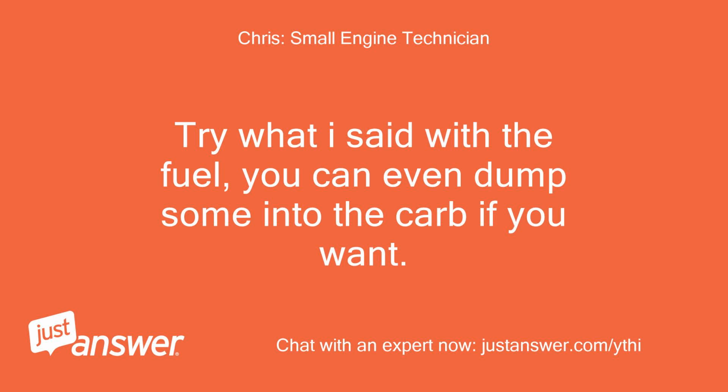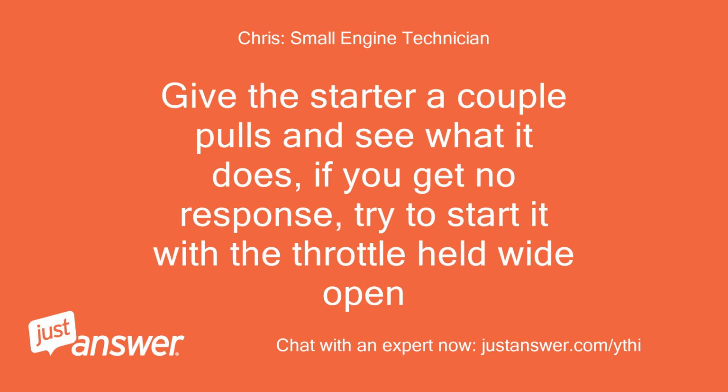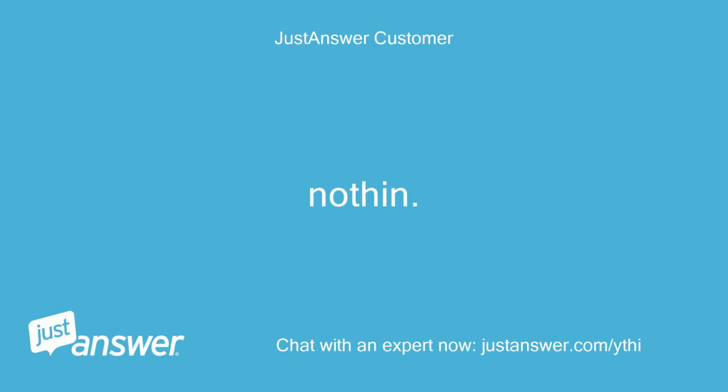Try what I said with the fuel, you can even dump some into the carb if you want. Give the starter a couple pulls and see what it does. If you get no response, try to start it with the throttle held wide open. Nothing.